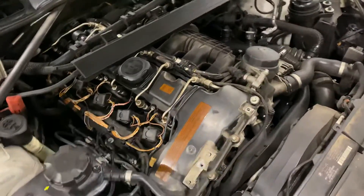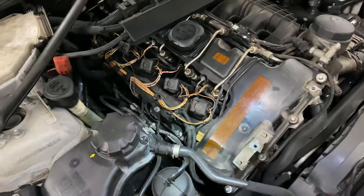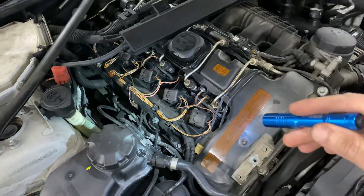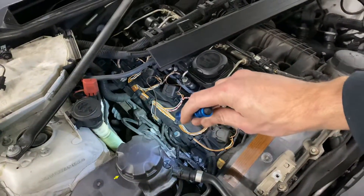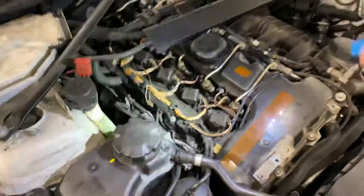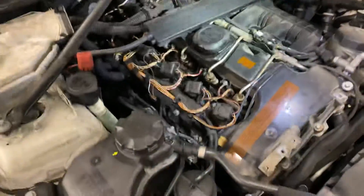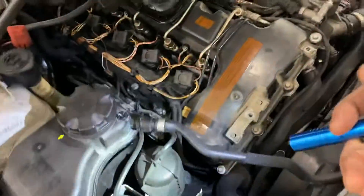It's not a good thing to do. So just wanted to put that out there — if you're having a 30FF code, follow your vacuum lines, make sure that they're not pinched, make sure they're not kinked, make sure they're not ripped anywhere. Besides that, go from there. If your turbos haven't been replaced and you're still having this 30FF code, it could be just bad waste gates or bad turbos. I've had another car where it was throwing a 30FF code, but the turbos were actually bad. There are other things you can check — you can check these canisters, you can bypass them just to see if they're good or bad, and then these two boost solenoids over there.